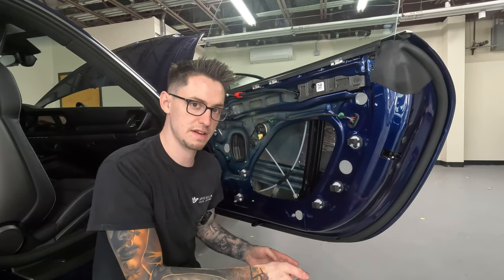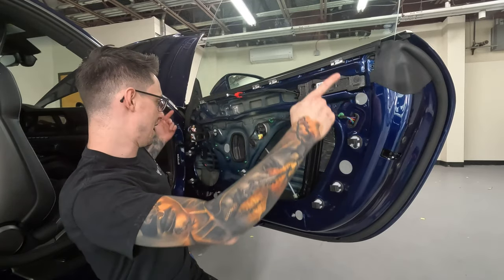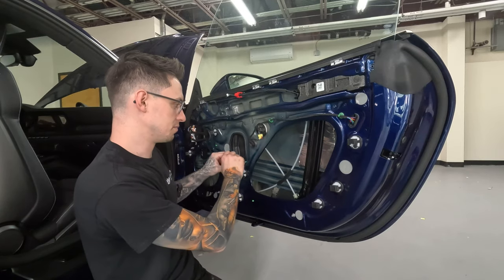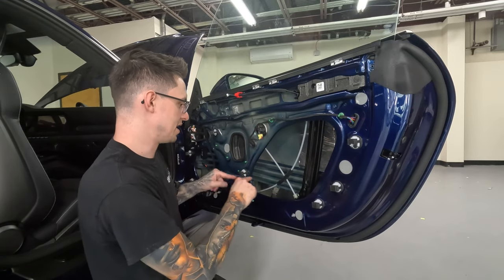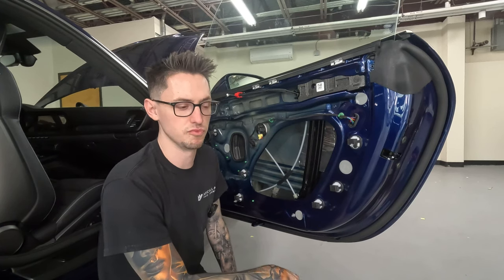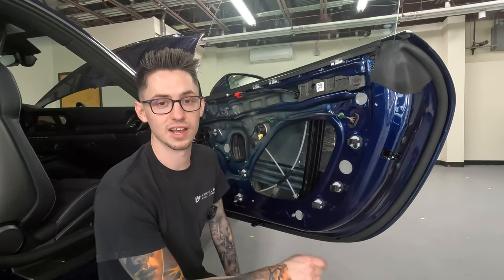The larger and flatter a panel is, the more resonant it's gonna be. If we have a panel that's this big and we have this crash bar and we essentially provide butyl rope support, we're essentially splitting it into two panels that are this big. So just a little tip, it's really quick, really easy, really inexpensive and pretty effective. So yeah, don't forget to do that as well.